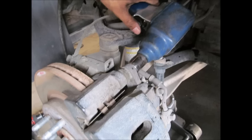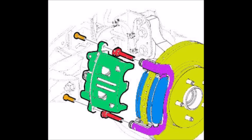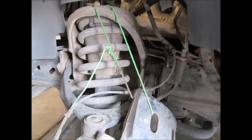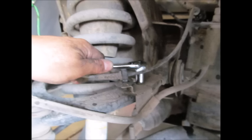Eventually you'll be able to move the brake over as you see in this picture. From there, you're going to take off the upper and lower caliper bolts — those are the ones in orange that you see in this picture. Take that one off, do the same thing on the bottom, and then hang the caliper up out of the way. You don't want to let it dangle because you don't want any unnecessary pressure on the rubber brake hose, so you may have to undo another bolt as shown here.